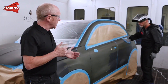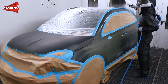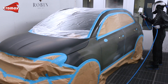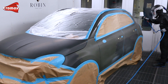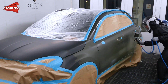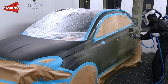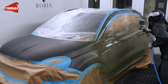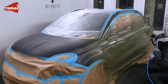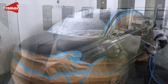Now the car is ready to paint. The base coat application process depends on whether you are using a waterborne or solvent borne system — refer to the matte clear coat TDS as there may be differences related to the base coat process. We are using our premium waterborne system which does require a small but critical change: you need to ensure the entire repair area is coated with either coloured base coat or blender. You must not leave any area uncoated as otherwise gloss differences will be visible. This applies to all our waterborne base coat systems for both solid and effect colours where the clear is recommended as part of a repair process. When using solvent borne base coat the application and blending process is as normal with no change required.